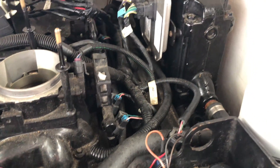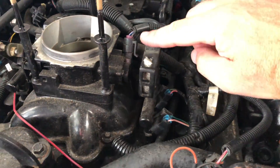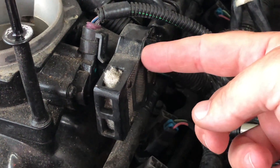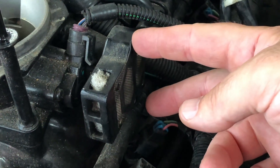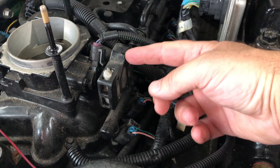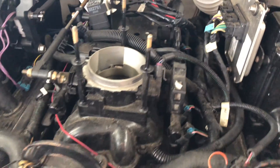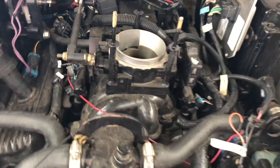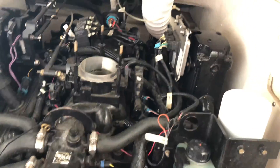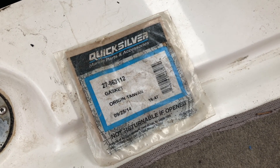Here's another difference to note. If you have the newer model like mine with the filter, you do not need to replace the gasket — the whole new piece comes with the gasket already, and it's about a $70 part that I don't think is necessary to replace. We'll mate the new IAC valve directly to this. However, if you have the older model with the filter located down inside the housing, you will want to replace the gasket, and that part number is 27-863-112.